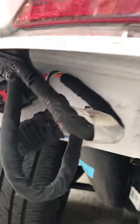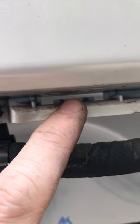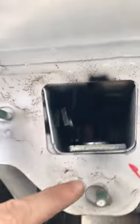So I just started taking the rest of the car apart. Two bolts hold this plastic piece — one over here, unplug your reverse sensors, and another one on the other side. This piece pulls right off and slides out of these slots. Then the crush bumper, that aluminum piece — three bolts on each side, it's a 13mm I think. You slide that thing right off and slide the bolts right in. Simple as can be.